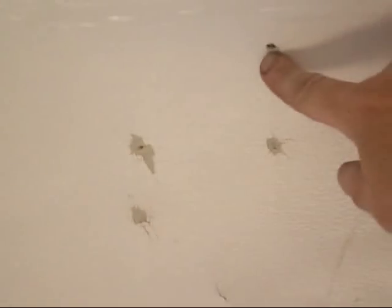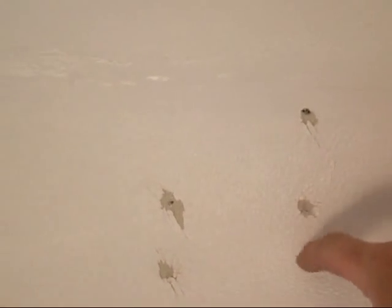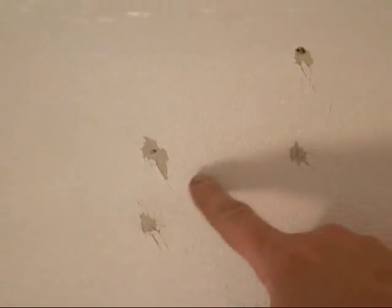Let's have a look on the inside. Here's the inside of my trailer — when I was drilling I did drill through the insulation, but I'll just patch that up with caulking and then repaint all this. This is latex paint — it's not too bad until it gets a lot of pressure on it, then it just peels right off, but it should clean up nice. Here's one of the actual rivets — it just comes through the fiberglass, which is about one-eighth inch thick, so there's about one-eighth of an inch that sticks out on the other side, and then the rivet forms the ball there so it can't come back through.